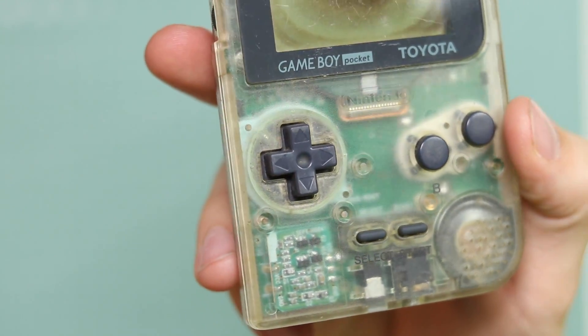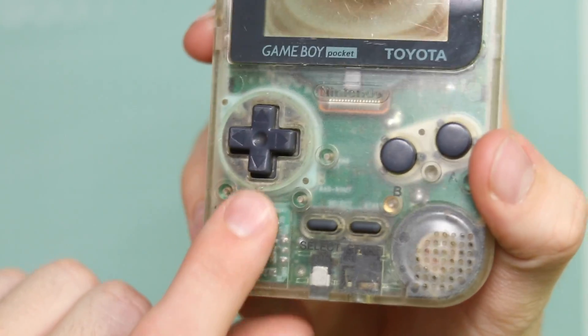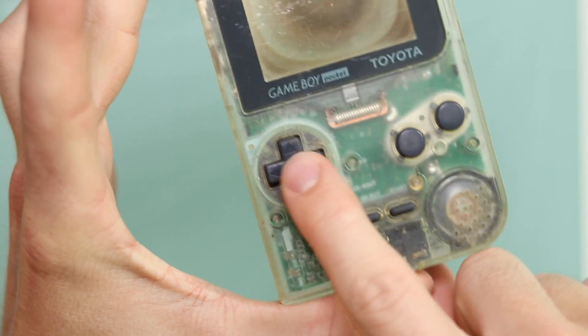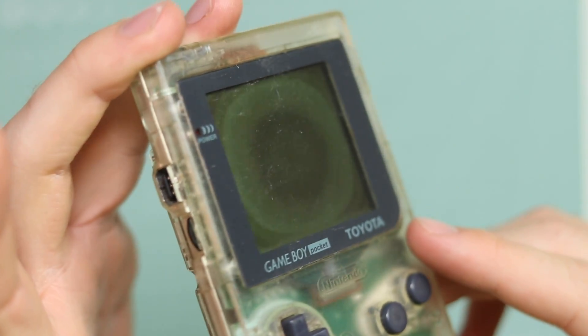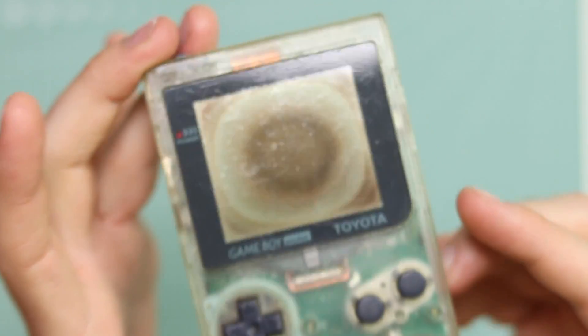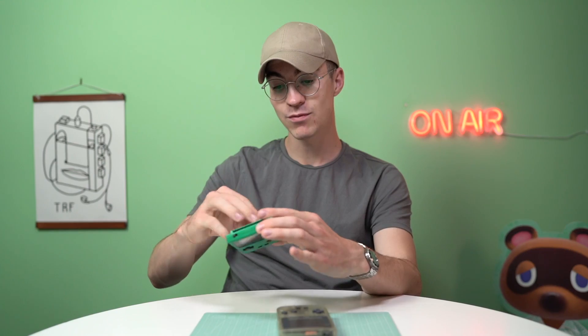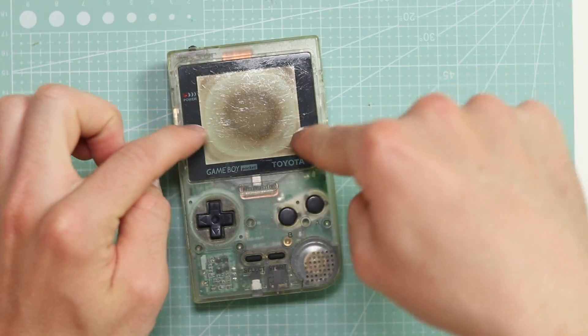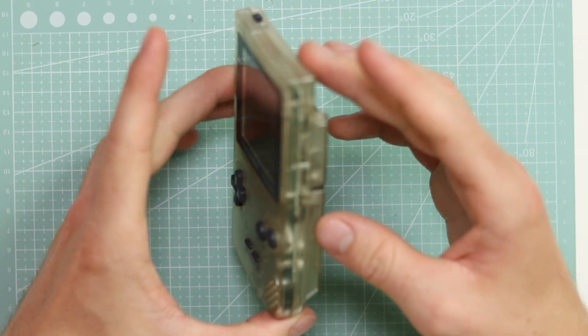Now this one is in dire need of a good clean. You can see it's got a load of congealed crud and dust and dirt underneath the buttons and in the speaker, and being that this is transparent, you can see all of the grime that's worked its way in through the holes and openings in the case. It's also got a very scratched screen lens as well as obviously the screen damage. Luckily we bought a Game Boy Light for £5 and it came with a Game Boy Pocket which has a perfect screen, so we're going to take that screen out and put it in here. We'll keep this nice and original and in mint condition as far as we can.